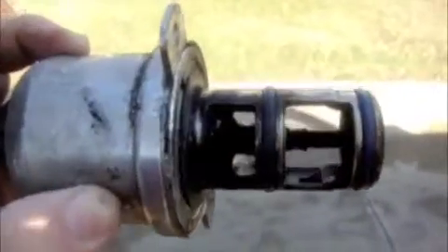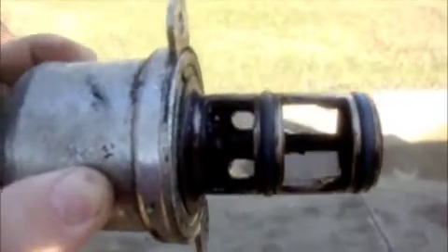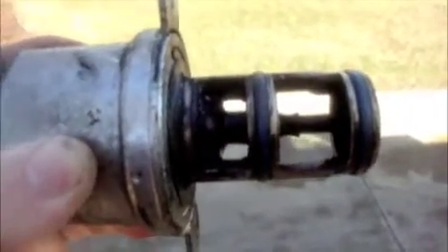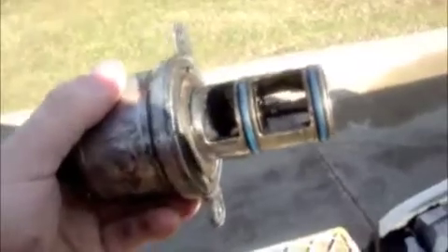After about 10 minutes in the sink, it's all cleaned out. You have your inlet on top and your outlet on the bottom. You just want to clean them out and make sure there's no carbon or soot in there. Visually inspect your rings — make sure they're not cracked. Inspect the valve; make sure there's no cracks around the casing or on top by the plug. Once you do that, dry it off and you're ready to reinstall.